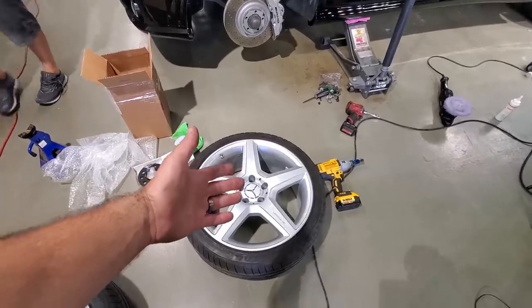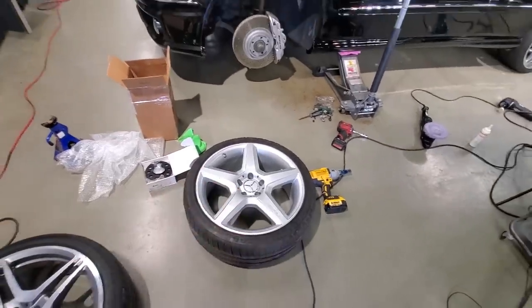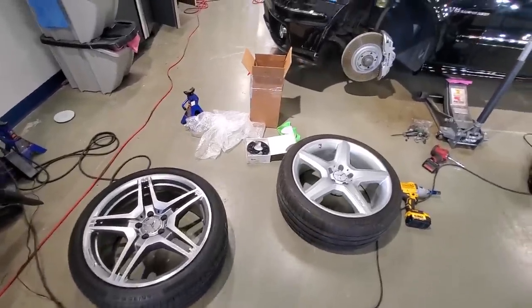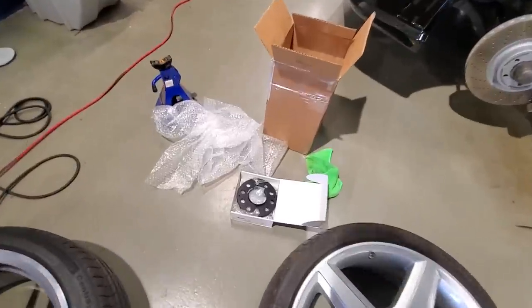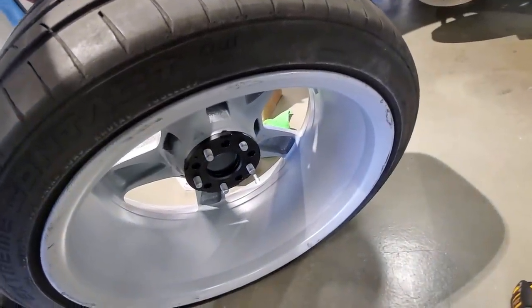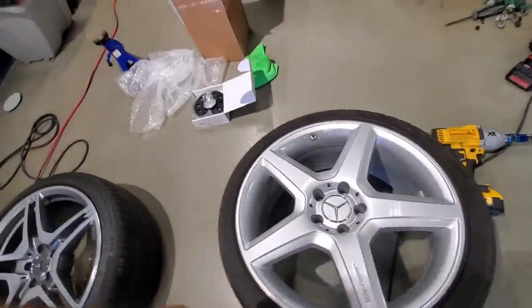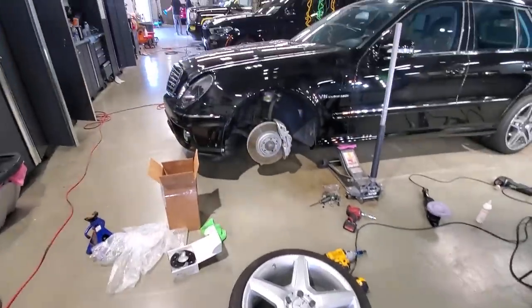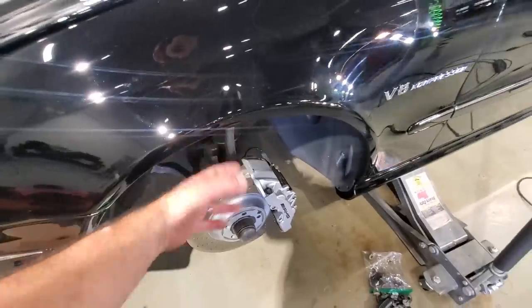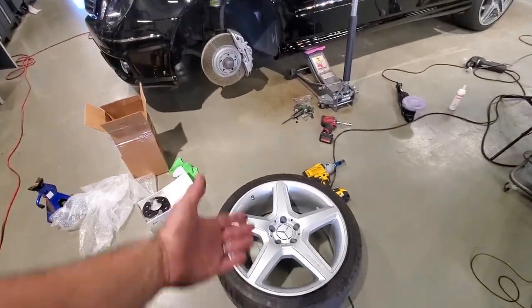The previous owner of the wagon spent $5,000 on these wheels with tires, but this is always what I've had in mind. I found these for $800 used, sent them out to my guys at Chicago Wheel, and they powder-coated them in the factory silver finish with new center caps. I have 10-millimeter spacers from fourwheelspacers.com. I already have one on the back of this wheel, and you can see the longer lugs are required — we have plenty of thread there. I have not run spacers on many of my cars, so we'll see how this looks. The suspension is lowered and we did roll the front fenders, so hopefully it tucks in really nicely.